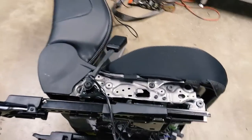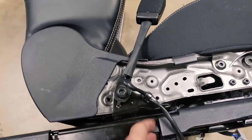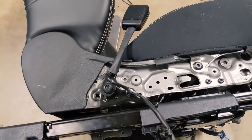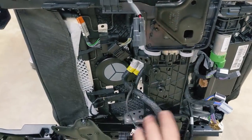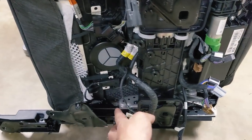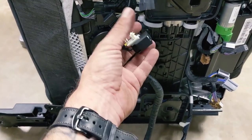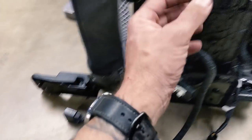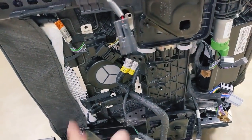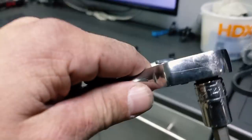One thing I forgot about is the seat belt. This is fairly easy to unbolt, but if you want the seat belt alarm to work properly there are two wires here. I had started removing this harness but it's so complicated and ingrained into this seat that I stopped. What I'll do is trace the wires from here — it plugs in right here — and the wires change colors. I found them over here, and I'll build a jumper from here to the stock plug so we don't have to take off all this wire. I'm unbolting the seat belt now — that's a different size Torx, a T45.